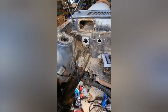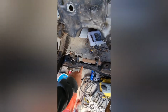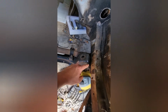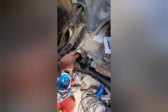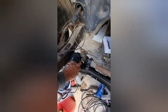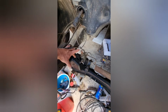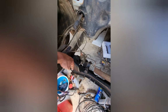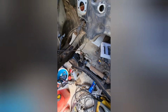So here we have in the engine bay a Nissan Silvia S13 SR20 subframe, and it already had the rack shifted forward, which I'm not exactly a fan of, but I cut and modified it to suit the Lancer. But the steering rack's from a C34 Laurel, so it doesn't match up to the Silvia mounts very well, so I had to hack out the mount just to fit it. But after further measurements, I want an RB mount because the engine mount will be out here, which suits better for a 4G63 to be mounted rear-wheel drive. And so this, we'll call it the prototype. It's going to get thrown out, but it's there for now.